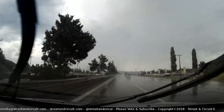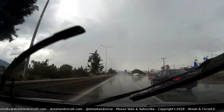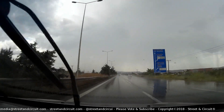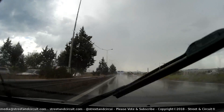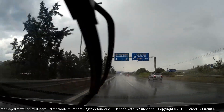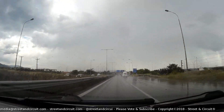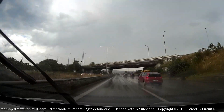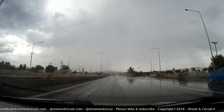And that's basically it — it's quite a simple process. Set the ride height where you want it. Set the dampers where they need to be so the ride is as comfortable as you want. If you go too soft on the dampers and you find that the springs are bottoming out, you can increase the stiffness of the dampers and that will stop the suspension from bottoming out. If you find that you're getting a lot of bangs from the suspension, increase the damping force and that'll give you more resistance to the suspension compressing — which is a very effective thing to do.